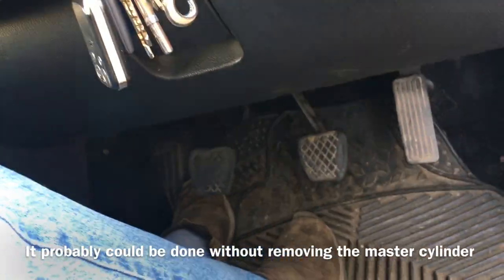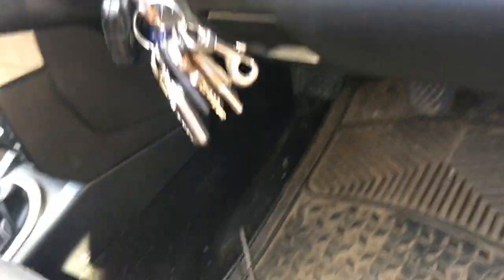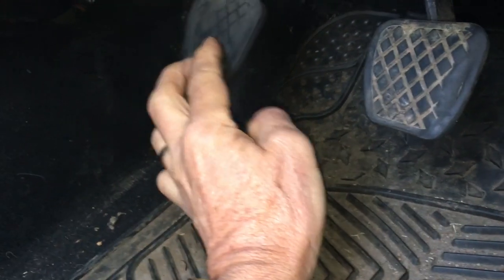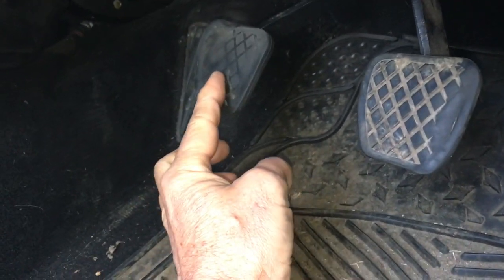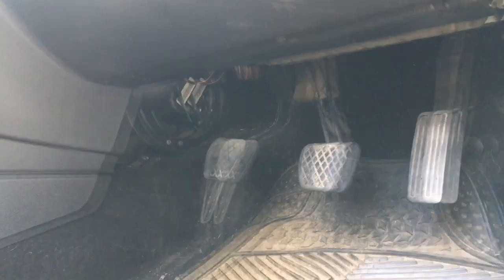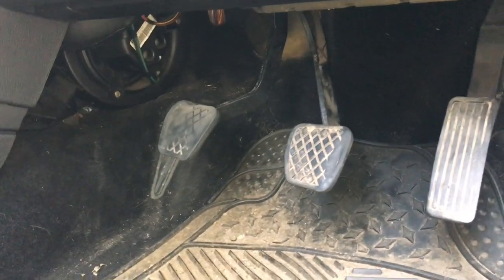That's how I quickly improved my clutch - I hope that helps somebody. I know a lot of people have been stuck trying to bleed their clutches. I think somehow a tiny little bit of air remains in the system - you can probably feel it, maybe that much, not very much at all - but where the clutch pedal is already sitting low on the floor, it's enough to make a difference and it was impossible to bleed out. Hope that helps, thanks for watching, bye.